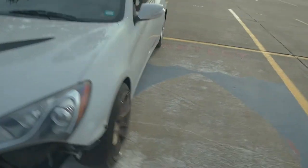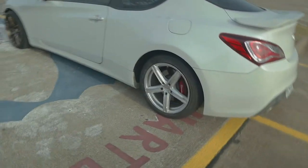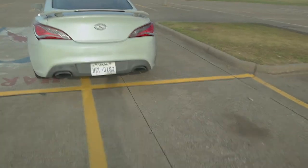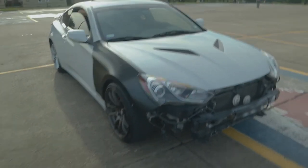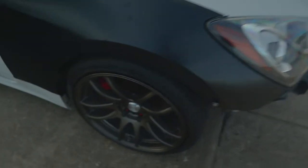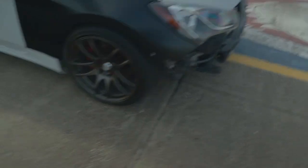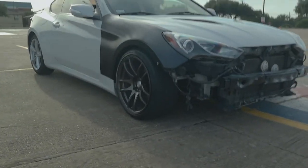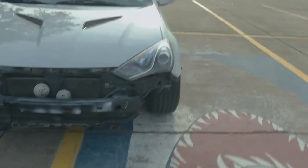That's flush, I like that, it looks solid. For the rears I need to order some new ones or figure out how to get these wheels to fit — I'll probably end up selling the 19x10.5s and getting new ones. It looks solid; maybe just lower the front a little. I'm not slamming this — I like the comfortability of not scraping and bottoming out. It doesn't shake or vibrate at all because there are hub centric rings in there: 73.1 to 67.1. This side is honestly the ideal fitment — sits perfectly.